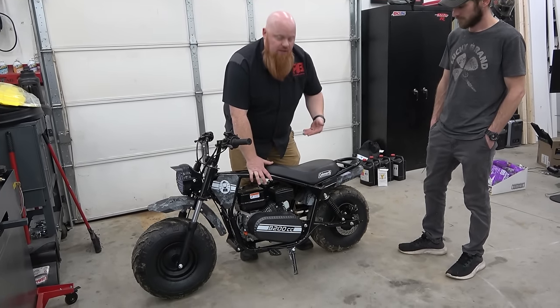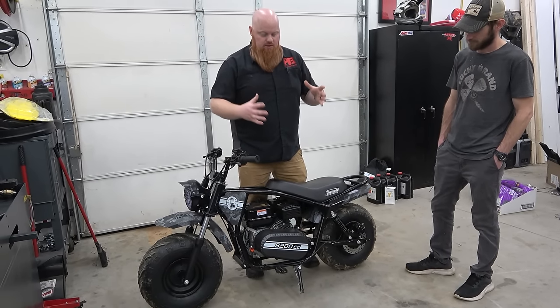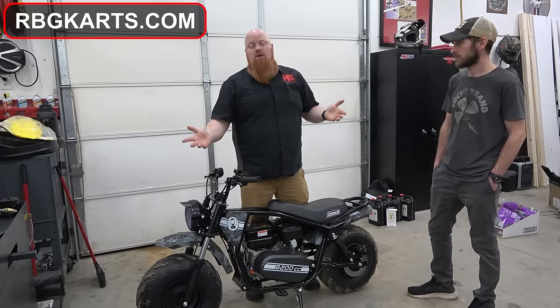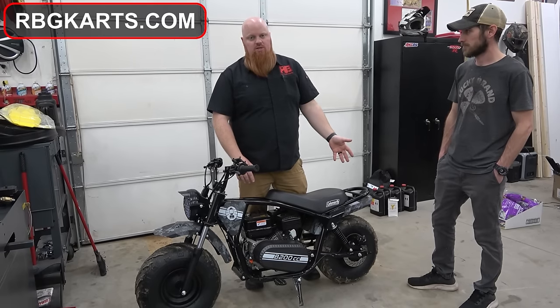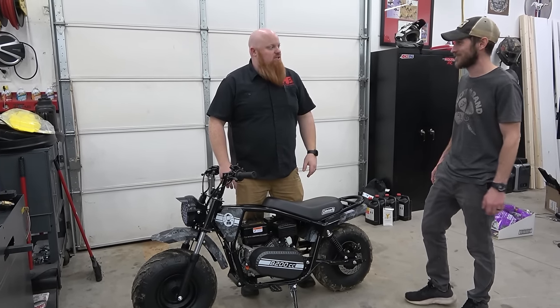The only problem is when you lift the back, the chain gets into the little jack shaft that's built onto the cradle of the engine. So we're going to come up with a bracket to raise that. Then we're going to have a kit on our website that comes with the spacers and the brackets. You just have to buy shocks off Amazon, and you can lift your bike 2 inches. Bam, Stovepipe is your sister.